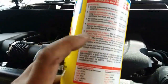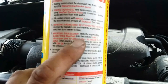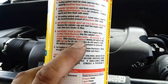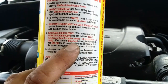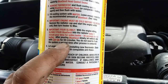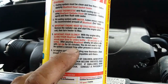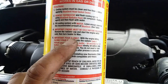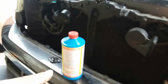Now what we're going to do is pour slowly with the engine idling. It should take about one minute to pour the entire contents of this. After pouring slowly — it tells you like three or four times — let the vehicle idle with the cap on for 50 minutes. And it should say to have the heater at max. So let's go ahead and do that: start the engine, remove the radiator cap, and pour that in nice and slowly.